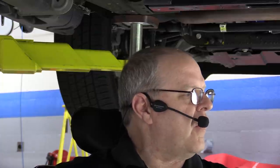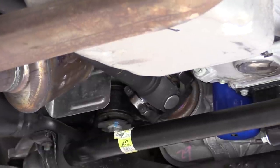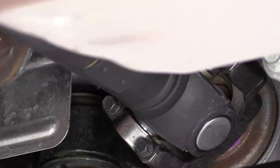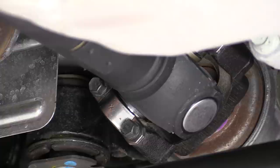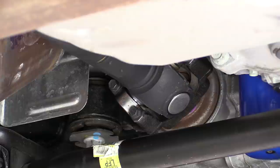The rest of the front drive shaft goes to the front differential, and it uses the same U-joint bearing straps that are not reusable — you must replace them on the front differential pinion companion flange. That covers the General Motors product and the unique features of its drive shafts and universal joints.